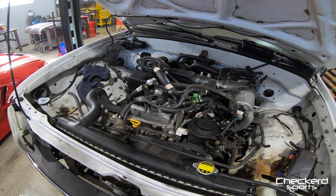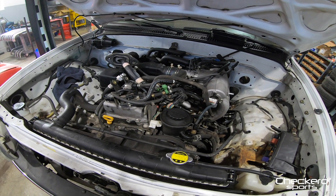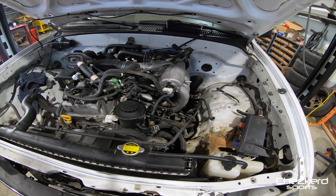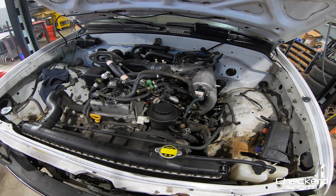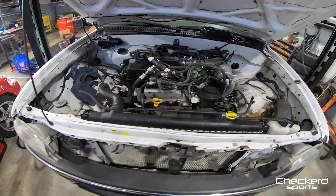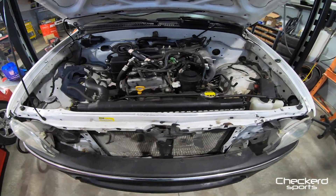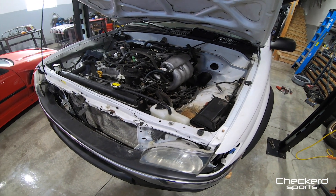So the engine — this is where I was at this morning. What I did was I disconnected all the engine parts that connect to the cabin or go through the cabin, the wiring lines, anything that goes from the cabin to the frame. What I'm going to do is just lift this cab right off the frame and then roll this frame out because I'm not going to use it.